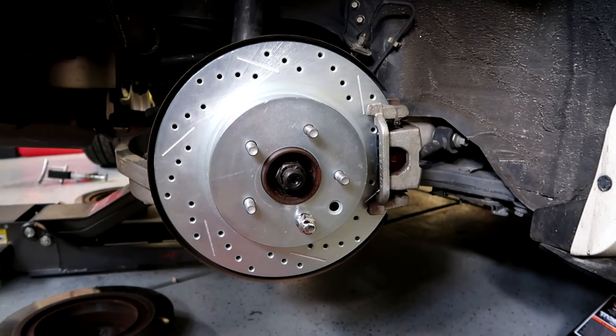Now I'm putting the wheels back on. We'll check the brake fluid level and also pump the brakes to get any sponginess out of the pedal. Before throwing the wheel back on, they do look really good — hopefully they stop a whole lot better too. One step closer to being track ready. The rears are on and they look phenomenal. Stay tuned to the next video where we'll be putting a big brake kit on the front. Thanks for watching — subscribe to the channel and we'll catch you in the next one.